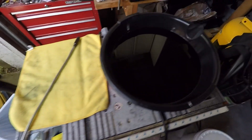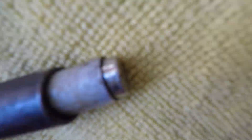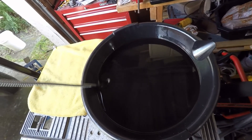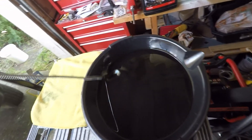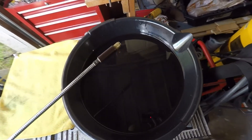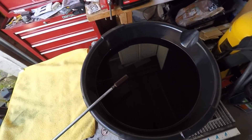There is one final thing that I like to do every time I change the oil. This is a parts collector — there's a little magnet on the end. Just make sure that you clean it off really well, and then what I do is run it in the old oil. What I'm doing is looking to see how much metal is actually coming off whenever I do my oil change, because when I just pour it out I can't always tell. So I do this for a few minutes — if I can see exactly how much metal I'm collecting, I can see exactly what's going on inside my engine. That one came off pretty clean, which is nice — just little bits of metal. Looks like pretty good, nothing major being shaved off from any valves or anything like that. We're in good shape.